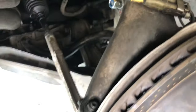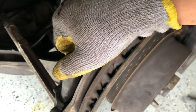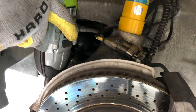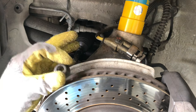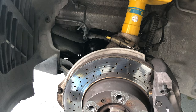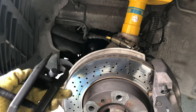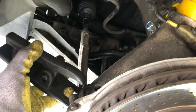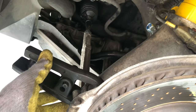Next I want to go to the lower control arm right here. This is a 17 millimeter. Just make sure that seats down properly before you crank it. Now we're going to use this tool right here — this end is a 19 millimeter bit. Usually I would be careful on this if I was trying to save the outer tie rod, but I'm not. I'm going to go ahead and replace it.